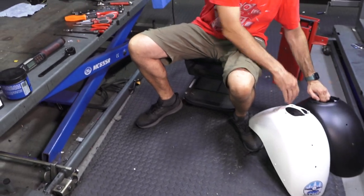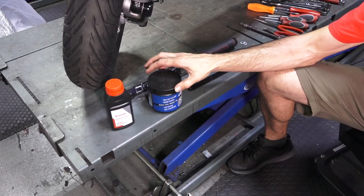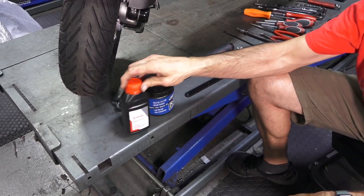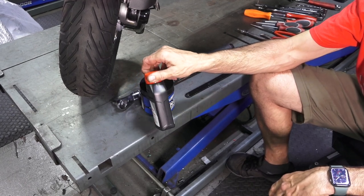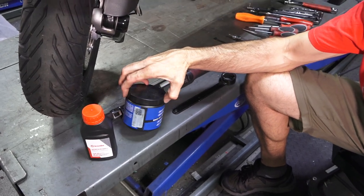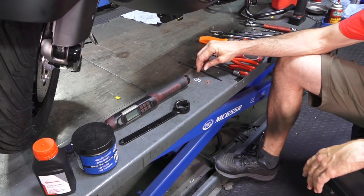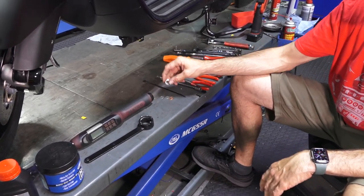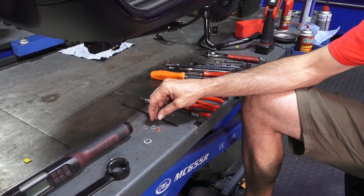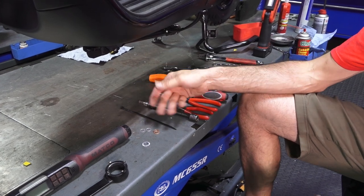Beyond the fender, there are a couple of other consumable parts you're going to need. You'll need grease to grease up the fork bearings. If the fork bearings are in poor shape or you have a high-mileage scooter, I'd highly recommend buying the upper and lower fork bearing kits. You'll need DOT 4 brake fluid — I recommend Brembo unopened high-quality DOT 4 brake fluid, available on ScooterWest.com. You'll also need a special tool — the four-prong fork bearing tool, part number SN from ScooterWest. Replace the handlebar pinch bolt lock washer, part number 012543. You'll need a pair of brake banjo crush washers, part number 127927 — need two of them, possibly four. You'll also need several zip ties.